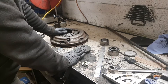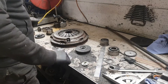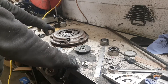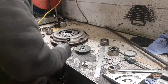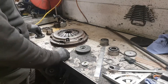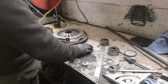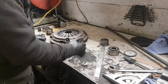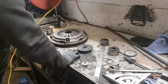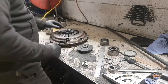I'm going to make a test rig for a clutch cover, which is going to involve bearings, making a load cell, and a little bit of programming. I think I've decided on how I'm going to do it. I've got it sitting on a brake disc, I've got more flywheels kicking about, and I'm going to use some threaded rod through the middle with some washers. These are out of a wheel bearing insertion kit, and then I'm going to have another one on top, with a nut and the threaded rod coming through.